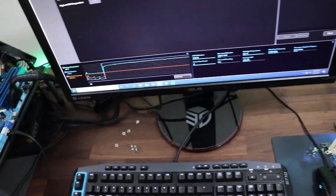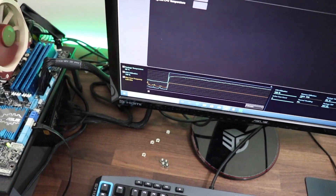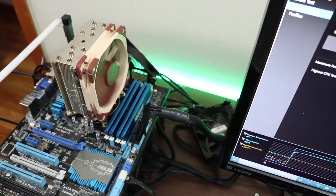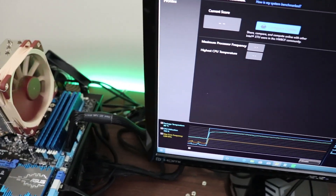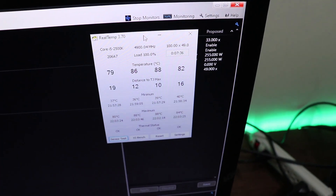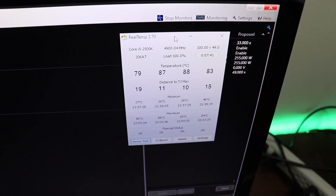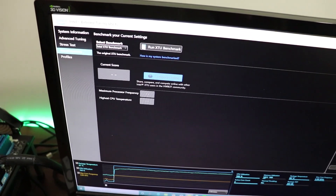The ambient temperature is a couple of degrees higher than when I ran the Coolermaster Hyper 212 test — that could be why the idle temps on the Noctua NH-U12S were a little bit higher. When we stressed the CPU, the temperatures are actually lower than the Coolermaster Hyper 212 EVO despite the higher ambient. The Noctua is able to keep temps under 90°C. So clearly the Noctua NH-U12S is the better CPU cooler — and for the money, it better be.